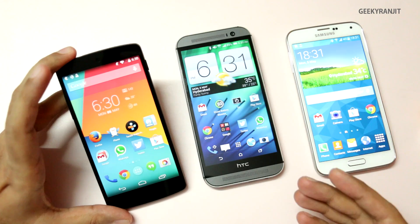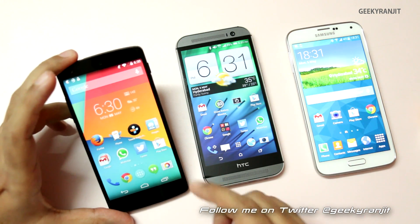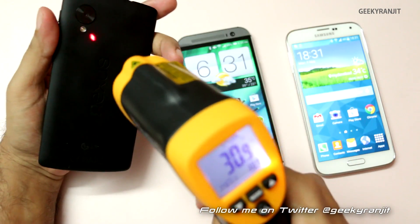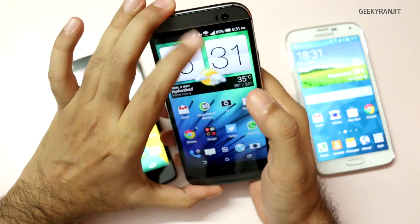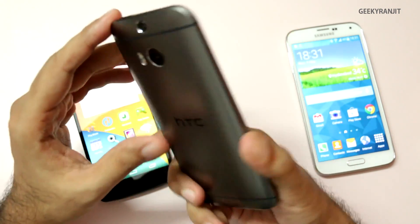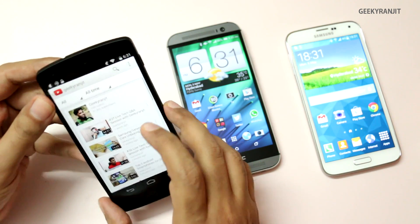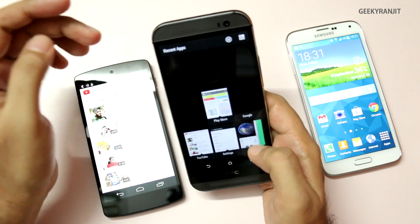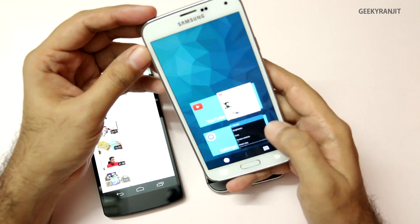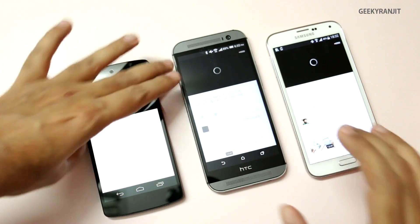We'll be using three tests: we'll play back a YouTube video for about five to six minutes to see how warm they get, then we'll run an AnTuTu benchmark, and then we'll also run 3DMark to simulate gaming performance and heat-up. For that I'm going to use this heat gun, which reads the surface temperature. Some people use battery utility apps that give internal temperatures, but I'm interested in the surface temperatures where you actually hold the phone. The S5 I'm using is the Exynos Octa-core version, and we'll be running the same video in full screen mode on all devices.